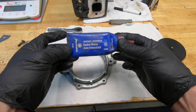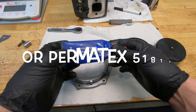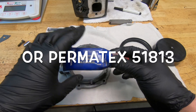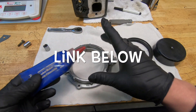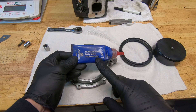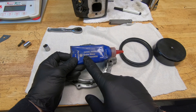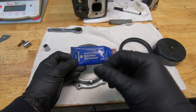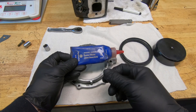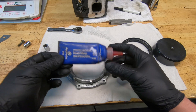You're going to need a tube of this if you don't have it — this is a Permatex 51850 anaerobic gasket maker. The reason why you want to use this, especially when putting the housing on, is we're not going to grab something thick like Right Stuff silicone. We need something that's a little bit tacky but stays kind of soft. You can use a really thin silicone as well, but I just use this — I started using it and it's worked out really well for me.